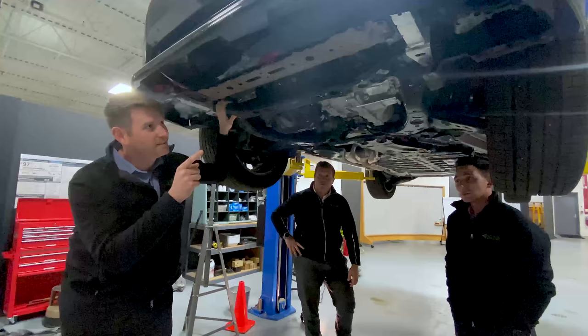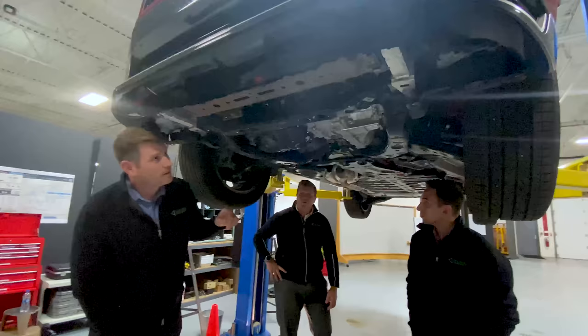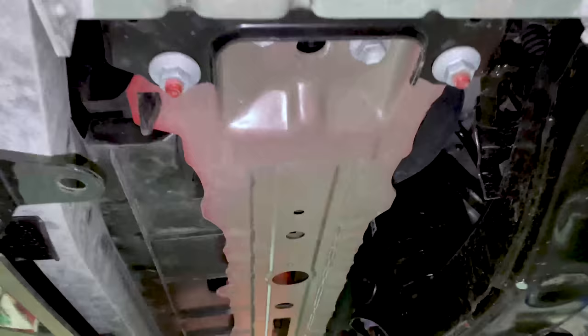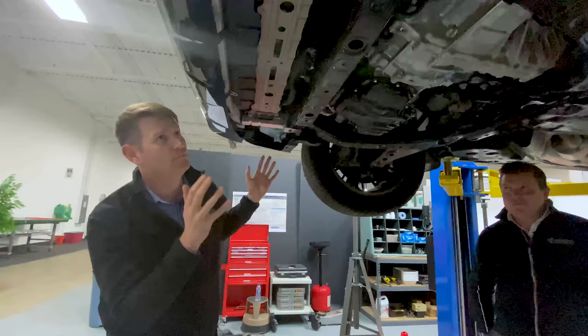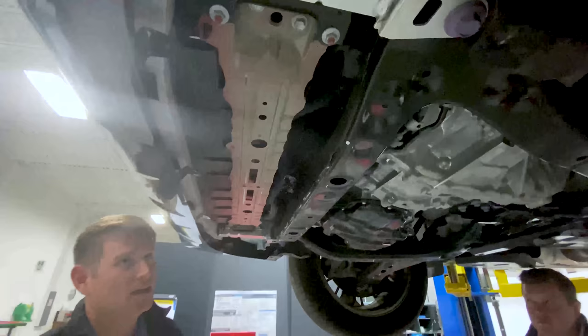Before we move farther back, the scalloping and castellization on the body structure at the lower front portion of the cooling module is worth noting. Following across the top here, nothing is straight — material is pushed out everywhere they have a spot weld, and only where they have spot welds. Toyota is known for having pretty small spot welding flanges — less material, less weight. The castellization reliefs help panels nest together and allow moisture and water to clear from the body structure, reducing corrosion.